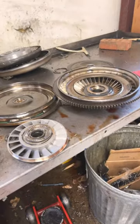We have the torque converter disassembled now, and we're going to show you one of the common causes of failure. The torque converter clutch is flaking off, as you can see. The clutches inside these drums will do the same thing — the clutch material gets in the filter and stops it up, causing the problem.